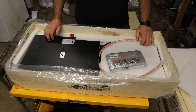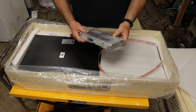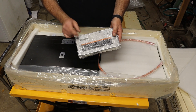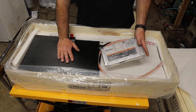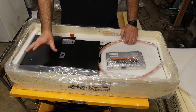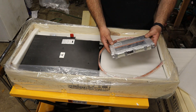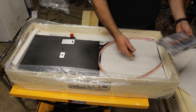Now we're getting into the goody goodies — this is where all the magic happens. This is the BMS that is programmed specifically for my 2013 Nissan Leaf. What this will do is allow the dash to read the mileage, bars, and range correctly on the screen. Once installed in the pack with these modules, it should look like a dealer installation — no turtle mode, all errors should be gone. This is the brains of the operation, and it's also used to balance all the cells. Very sophisticated device.